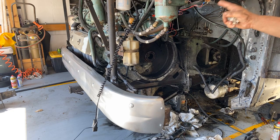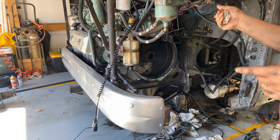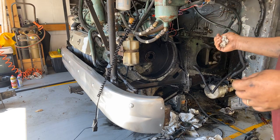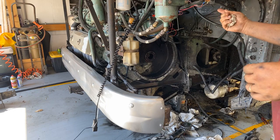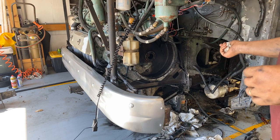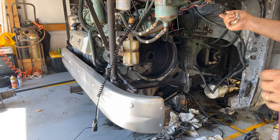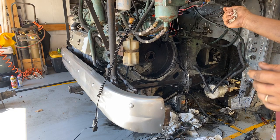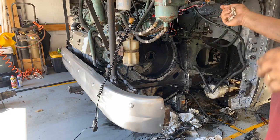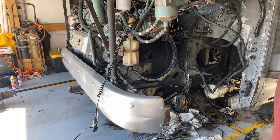This is actually a blessing that we noticed it. We also have to pull the starter out and put a gasket on it because the flywheel will now be a wet flywheel, which it never used to be. The starter not having a gasket would cause transmission fluid to leak out. Most starters are sealed with a little O-ring inside so fluid can't get into the starter itself, but we still have to put a gasket around it to stop it leaking from the mating surface.